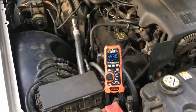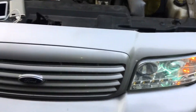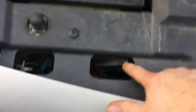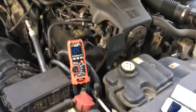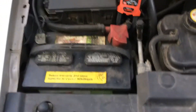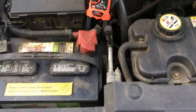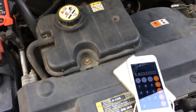We'll turn on the parking lights — we're at six and a half amps. Seems like a lot of current for just parking lights. Now these are HID — not halogen — 35 watt HIDs, I believe. Now we're at 15 amps. Let's see: 70 divided by 12 — that's only six amps. Oh, six plus the other six, so 12.